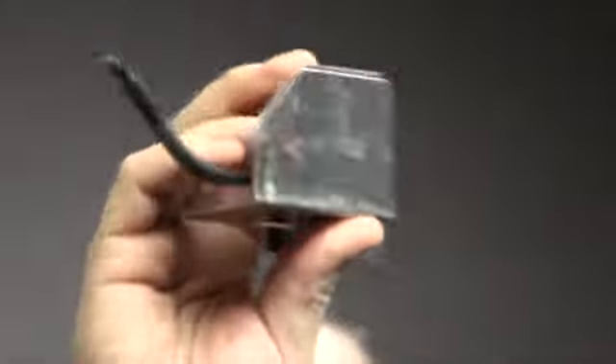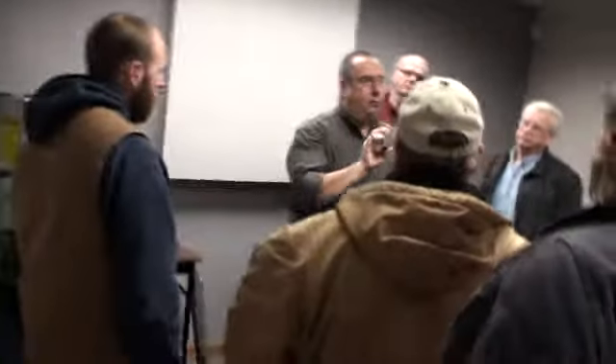Just so you know, if you have a machine that you just bought from Bill or from Chris and it is giving you EO2 error codes, check for this shroud. We had a thousand machines come through the factory and for some reason this shroud wasn't installed. That shroud acts like an insulator - it takes away stray voltage off the sparker. On some of them that came through without it, we're getting EO2 error codes. Let us know if that happens to you and we'll send you a brand new sparker with the shroud.